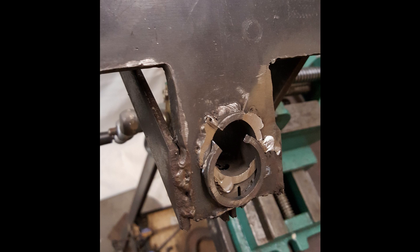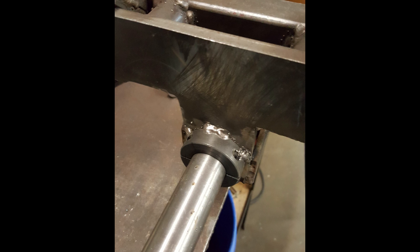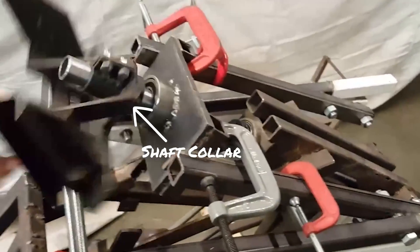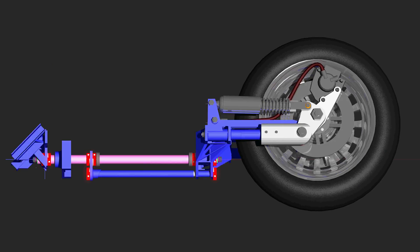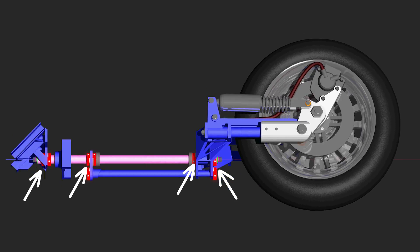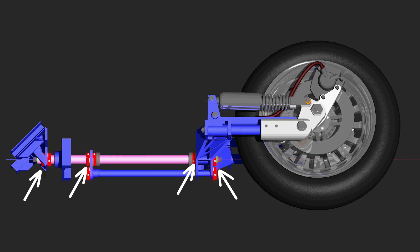To mount these, I removed the remnants of the fabricated clamp I was going to use, cutting it off and grinding it flat, and then welding half of the shaft collar to the fork T. Just to be on the over-engineered safe side, since this is my steering, I'm going to weld a shaft collar on both sides of both the upper tree and the lower tree, and also a shaft collar on both sides of the parallel bar that runs alongside the steering column.